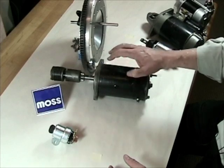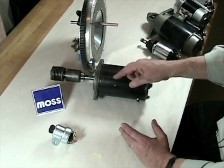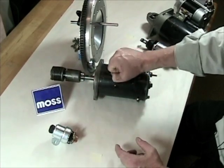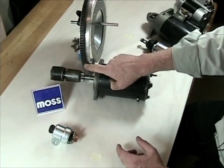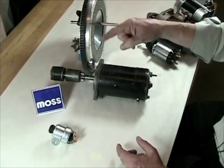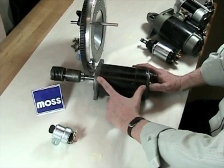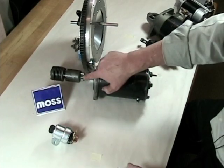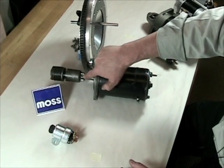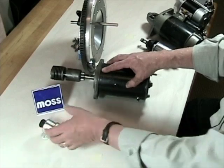This system has a tremendous advantage and a tremendous disadvantage. The advantage is simple: when the starter solenoid sends power to this starter motor, it comes quickly up to full operational power, and the pinion comes right along a moment behind. That means the motor is at full power, full torque, full RPM when it hits the flywheel — all that energy, all ready to roll, gets the engine moving quickly. The negative is that a spinning gear hitting a completely stationary gear is a violent event. This was brutal on the pinion gear teeth and brutal on the teeth on the flywheel. The industry needed something that was going to do a better job of not harming things.